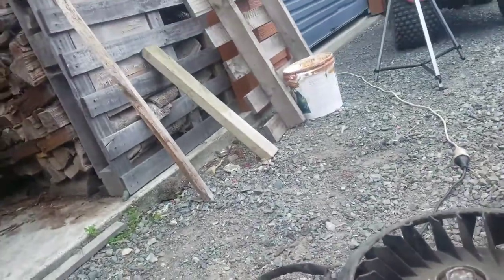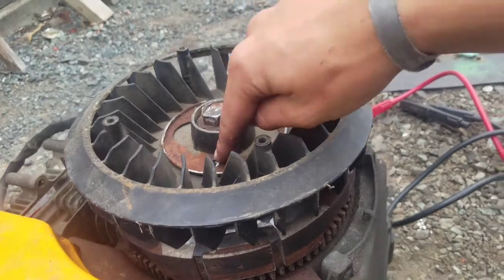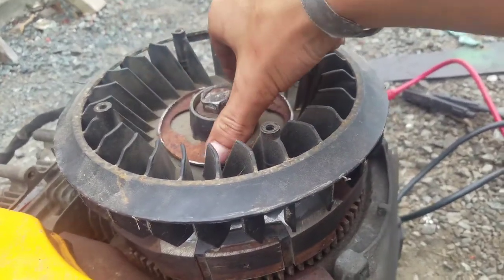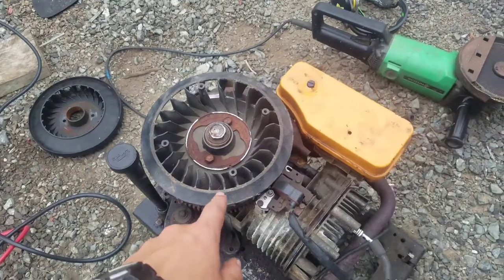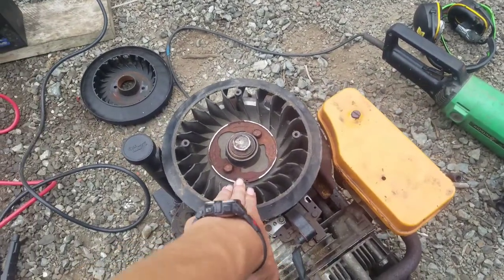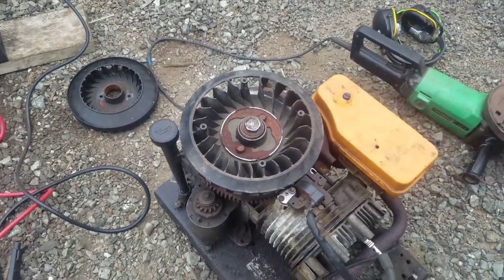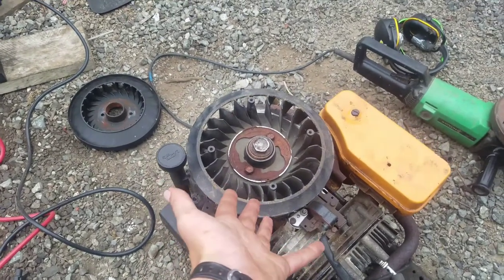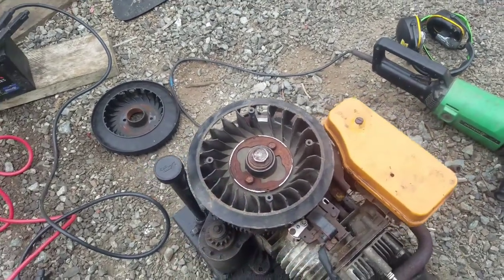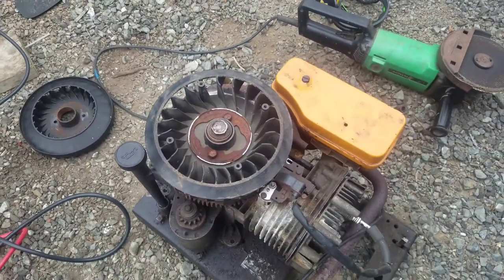And for this disc for holding it on, when it's on there, I've taken the top parts of that disc off. Every gram counts. So all in all, I've removed about half a kg from my flywheel. I will probably be using a big heavy billet pulley, so it's not gonna make too much noticeable difference, but it's gonna be better than not having it.